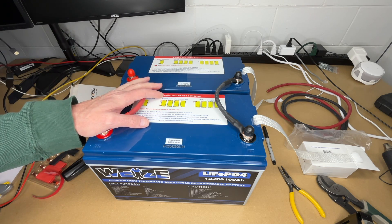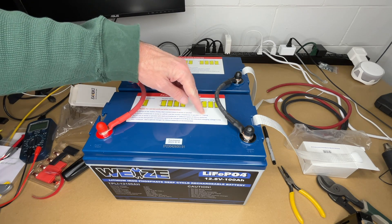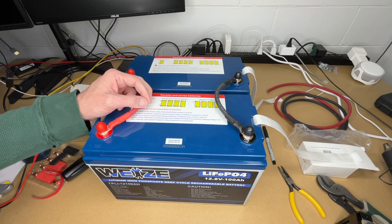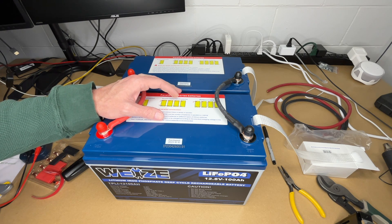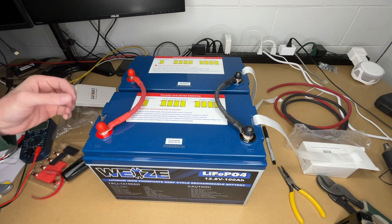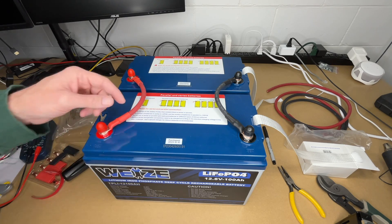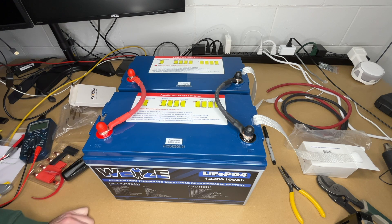We just paralleled two batteries, but you could parallel more — the battery specs say up to 10 in parallel. In that case your wires are going to be bigger and it's a more complicated setup. The best way to do an installation like that would be a bus bar — a copper bar on either side with each battery jumpered to it. If you added a third battery here, this four gauge wire would likely be too small since I sized it for two batteries. If you have any questions, please leave them in the comments. If you like this video please click like and subscribe. Thanks for watching — goodbye.